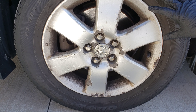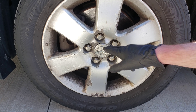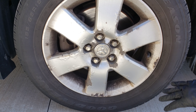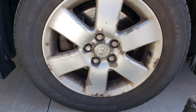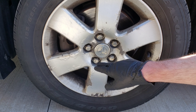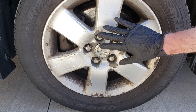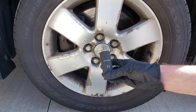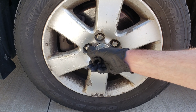So in this case, the tire and wheel are already on the car — these are already tightened down. We're just going to use the torque wrench to check and ensure that these are 76 foot pounds by using the star pattern. But if you needed to put the tire and wheel on, you'd put the wheel on and in the star fashion you would hand tighten the lug nuts. You want to make sure to do it evenly — don't just crank one down as hard as you can. Do them evenly in the star fashion until you get them all hand tight. You need to ensure that the wheel is seated properly and evenly against the rotor. The next thing you would do is use your 21 millimeter socket and in the star fashion, put it on and use your hand to get it as tight as you could.